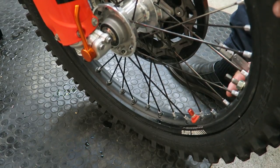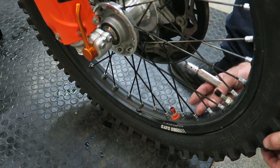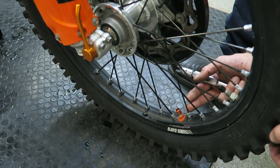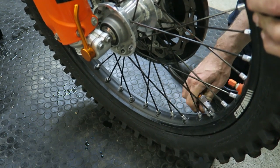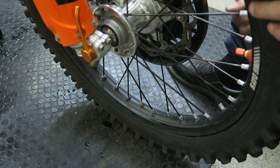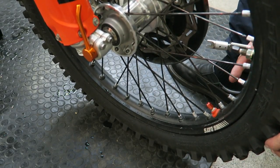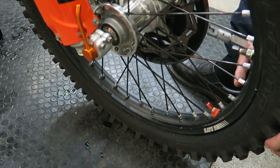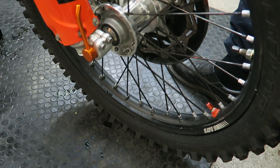The reason you skip two is that the first spoke you tensioned goes to one side, and the spoke two positions along pulls the other way. By doing that you can balance the tension and it doesn't pull the rim out of alignment. Skip two again and carry on going round, torquing and skipping two spokes at a time. Work your way right round the wheel back to the valve, then start on the next one along and skip two again — go right round three times and you should have covered all the spokes fairly evenly. If it's very loose you might need to do it a couple of times, but don't tighten any spoke more than about half a turn maximum.